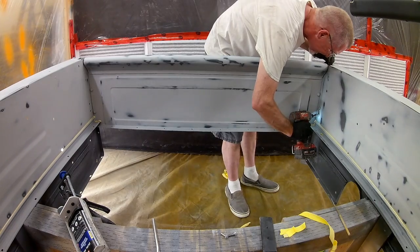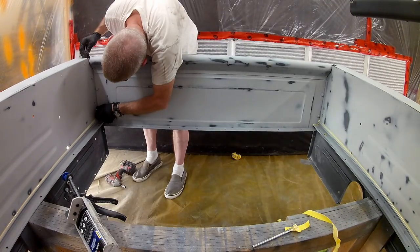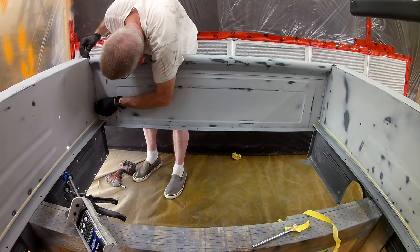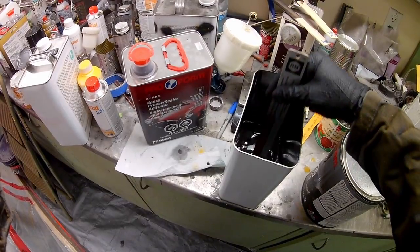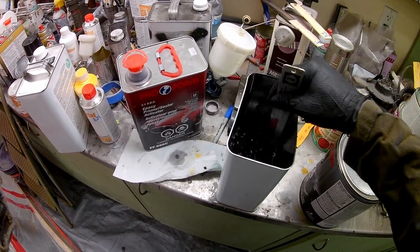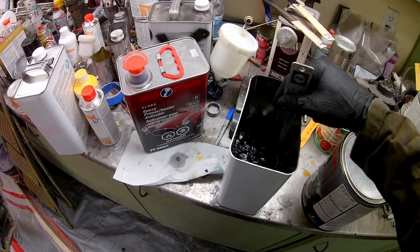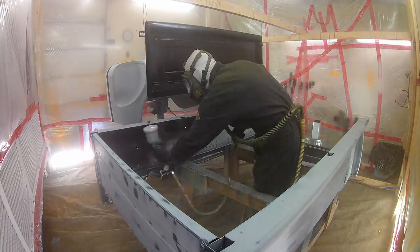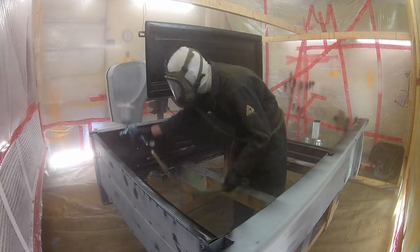With the 2K seam sealer hooking the stuff up and locking it into place, I should have a good way of tying stuff down. I don't want to use the bolts in the bottom that hold the bed sides to the floor, because I want to make sure I can carry a 4x8 sheet of whatever and I need the room. Getting ready to spray some more epoxy primer on the bed and all of its related paraphernalia — which is a fancy word meaning 'stuff,' but you sound smart when you're using polysyllabic vocabulary.